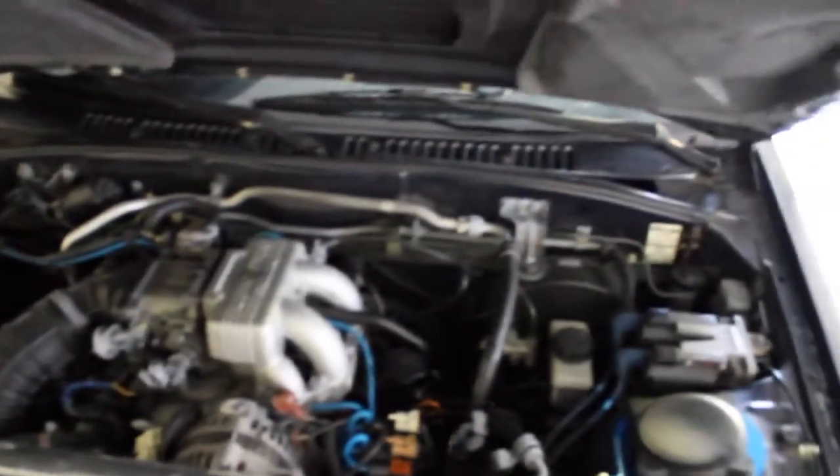Alright guys, one of the things you'll need to do, e-brake, whoops, danger, e-brake on, pop your hood, gotta get the master brake cylinder cap. Unscrew it, because when we spread the brake pads, the liquid has somewhere to go, so we're not gonna bleed them. I'm just gonna do one at a time.